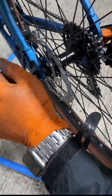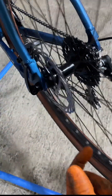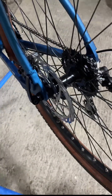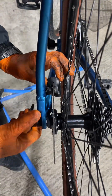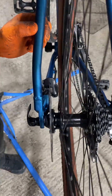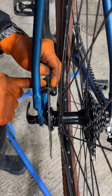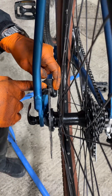The lever doesn't have to be soft, but not too hard either, because otherwise you are going to create friction in the bearings and obviously it won't be the right performance. When you get the wheel back, make sure the disc is not touching anywhere — it shouldn't make any noise apart from the clicking coming from the cassette. Make sure the disc is not touching any of the pads on either side.